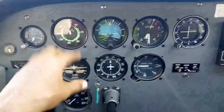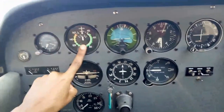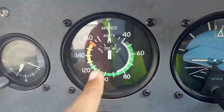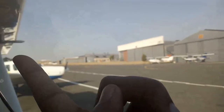This is what you call your six-pack — six instruments. This six-pack gives you basic flight parameters like your speed, airspeed in knots. The airspeed is driven by the pitot tube or the pitot vane or the probes, that one over there.